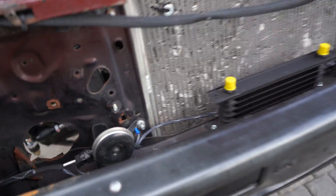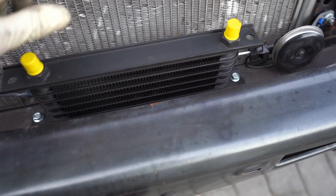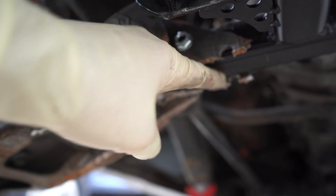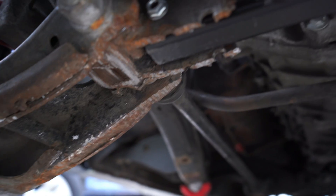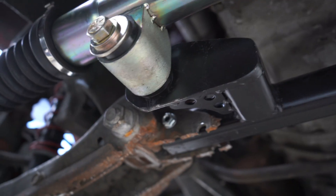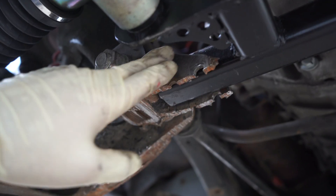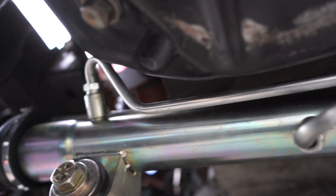While I was waiting for my nephew to finish drilling holes in the crossmember, I actually rib-nutted and mounted the oil cooler for the rack and pinion and the power steering pump. Let me show you what we did. It's supposed to mount here, here, and there — and there was supposed to be another one there — but we ended up drilling another hole at the very top. So instead of welding it on, I can now bolt it on and off: one bolt here, one bolt there. Whenever I need to replace the rack or do any maintenance, I can just bolt it on and off. I'm extremely happy with that. And even with the beam swap, I still have room for activities.